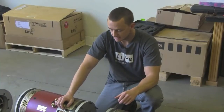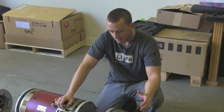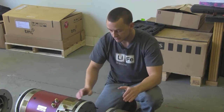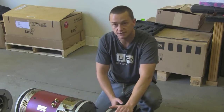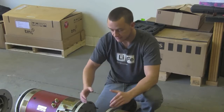One of the first things we need to do is cut these shafts down. They come pretty standard universal, about 3-4 inches long. Here at EV West we really like to make everything as compact as possible, so we actually have our inter-motor flanges down to 3 inches. That means we need to cut these motor shafts down to just a little less than an inch and a half each, and then we can couple them together.